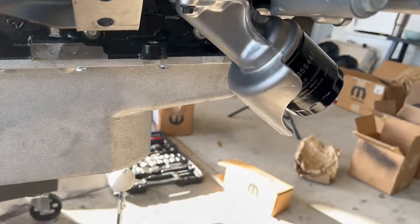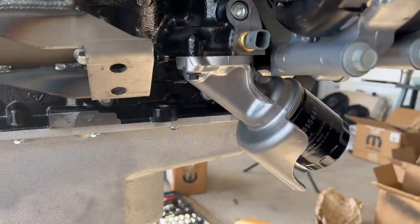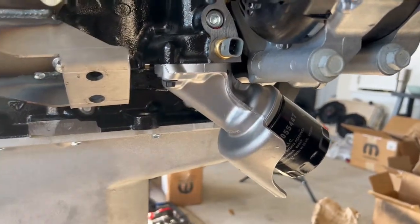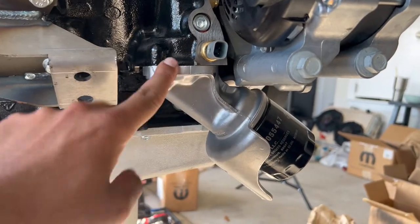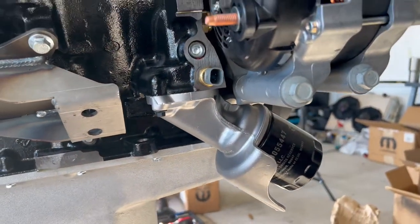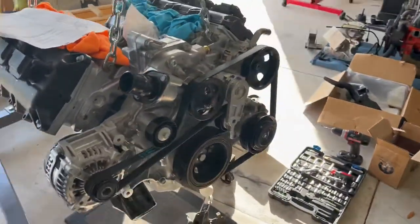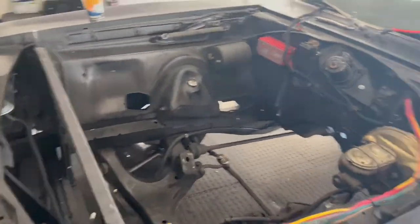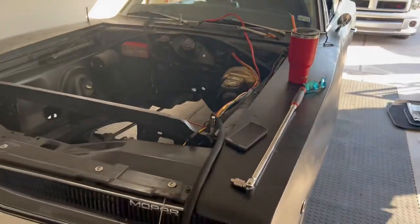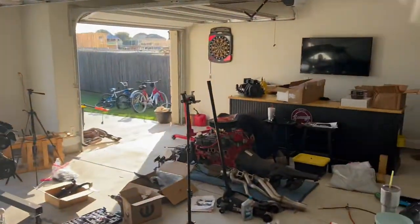Fun fact for the swap: we had to put on an oil filter adapter kit — a 45-degree kit — but we didn't have the right socket to get the OE screw-on fitting off. We didn't have the tool, so we had to go get it. Now we've got the complete drive kit, it's all on the front. Now we're going to put the engine mounts on and slap this bad boy in there — remove the Charger back and we should be able to get it in.